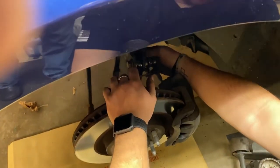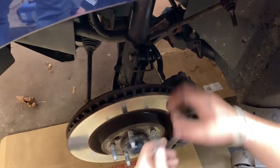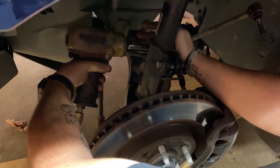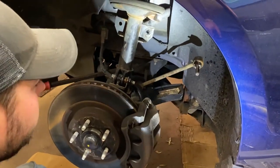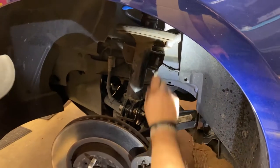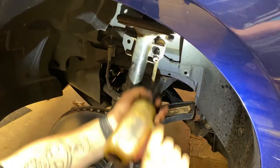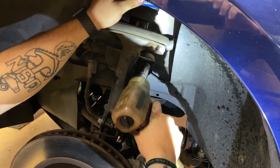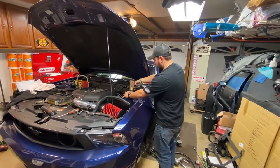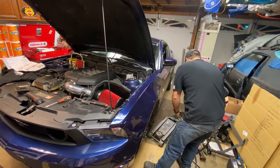That's our wire back into our strut, right down here. And then we can get our 10mm bolt for our brake line and go ahead and place that back into position. To get the end link back in, we're just going to do that same thing — pry down on our sway bar, then take our nut and stick it on a couple threads so it's still kind of loose. Make sure our gun's on max. Go ahead and tighten our 21mm nut, and we got that tight.